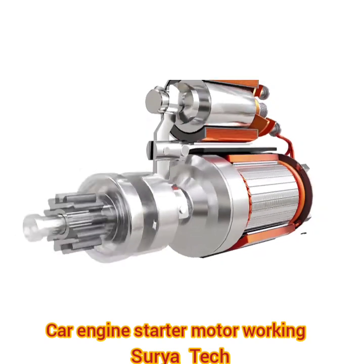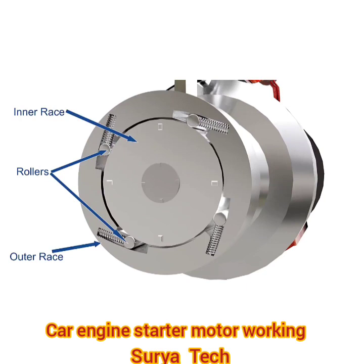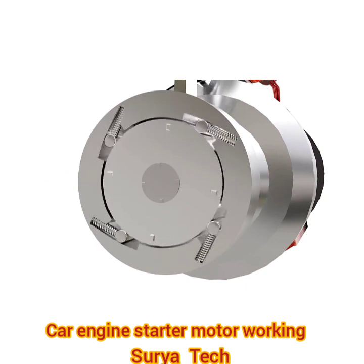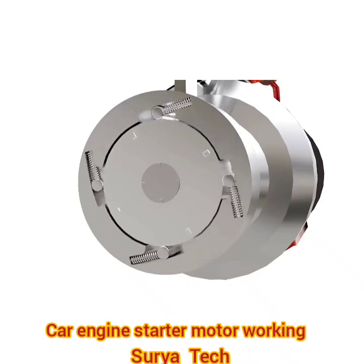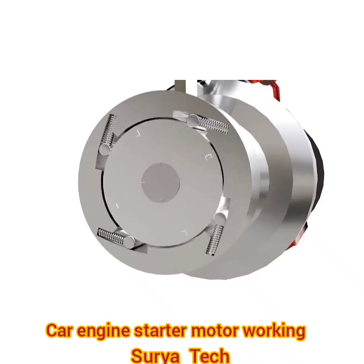To prevent this, a one-way clutch is used. The one-way clutch has a set of rollers installed between the outer and inner races. When the outer race is rotated by the motor, the rollers get trapped and transfer power to the pinion. As soon as the engine is started and drives the pinion at a high speed, the rollers get released and power transfer is stopped.